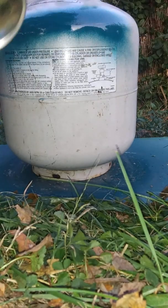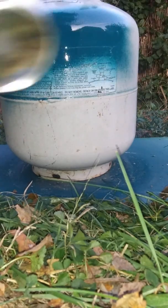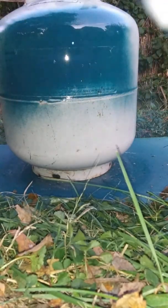So as I'm spraying, I'm lifting my finger up off of the button on the spray paint can. And if you listen, you can hear it. Spray. So I'm doing spray, lift, spray, lift, spray, lift. And I am going in a reasonable way, just heading all the way down.